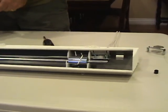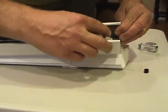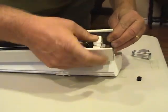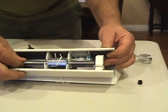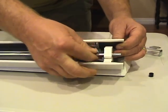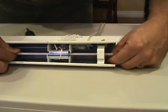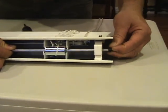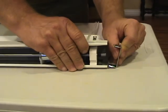Once the tilter has been removed, you can go ahead and reinstall the new tilter — exactly the opposite process. Clip it into the headrail. Slide the shaft back into the new tilter. Reapply the retaining ring and any other retaining rings that were on there. Then you can reinstall the end caps.